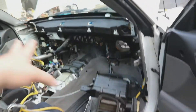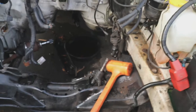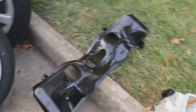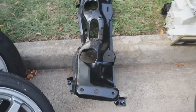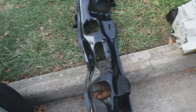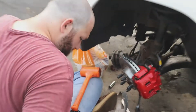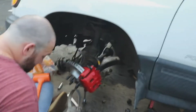While I'm getting the harness figured out, our freshly shaved friend is working on getting the front subframe and cross member disengaged from the rest of the car so we can get the NA subframe out and replace it with this brand new from Subaru WRX boosted subframe. The big differences are these huge scallop cutouts that let the exhaust be routed to a turbo and actually clear the up-pipe. This clearly proves you do need a WRX subframe if you're going to boost this car.